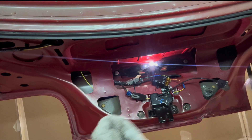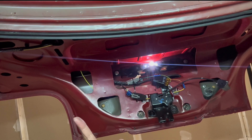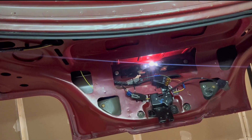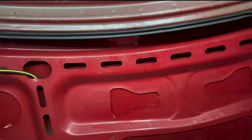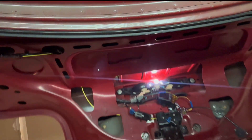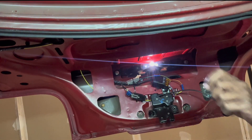All right, I think I got it. This thing right here is like a mercury level switch, so as the trunk goes down it breaks the circuit and that light turns off. I ran the 12 volts to basically the main 12-volt feed for this light setup up here, and that's down over here by the inertia switch. So now let's give it a test — make sure everything lines up, that light should turn off. There we go, it works like a charm.